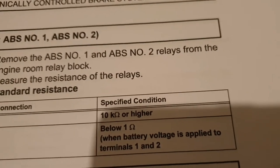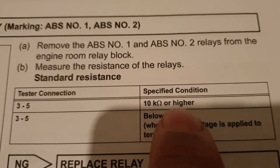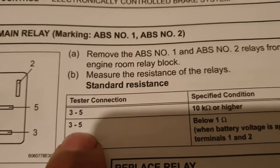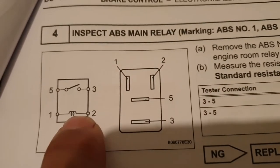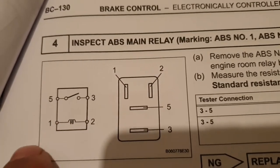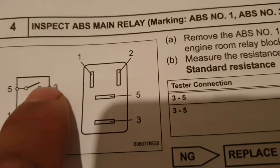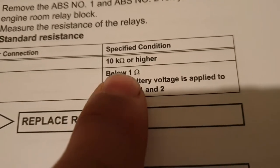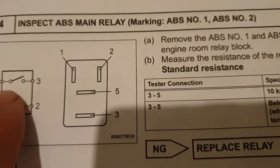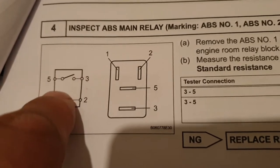When the contact is open, 3 and 5 should have more than 10 kilo ohms or higher resistance. So when 3 and 5 is closed, 1 and 2 is connected, or the circuit of 1 and 2 is completed. Then this 5 and 3 contact should be less than 1 ohm. So when this relay is worn out, the contact closes, opens, closes, opens,